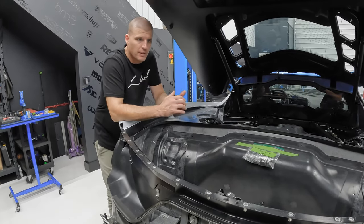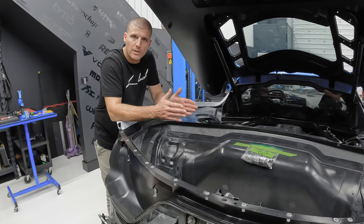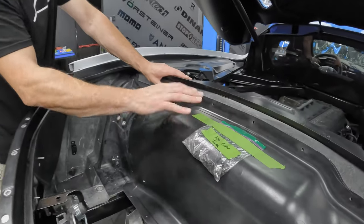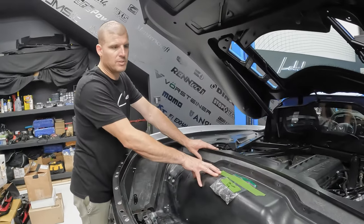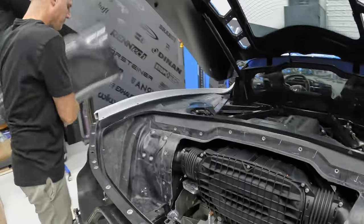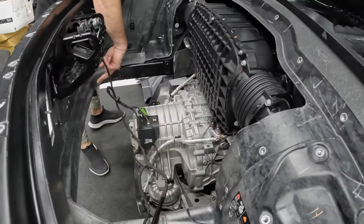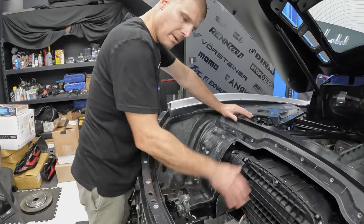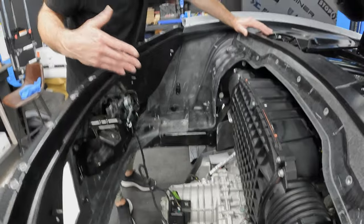What I wanted to show you today - we've already got a little bit of preliminary work done on this vehicle and we're going to show you guys a little bit of behind the scenes of what we do to prep before the exhaust portion even goes in the car. The first thing we do is we always make sure that the access cover will always remain accessible, so when we put the car back together you'll be able to service this car just like a factory car. We've taken out the floor all the way back to the impact bar, which will give us the clearance to run and access all of our exhaust system, bring our X-pipe up into the center section, and exit it through the bumper.